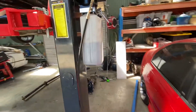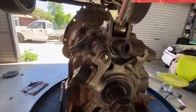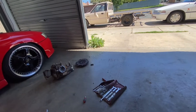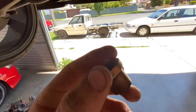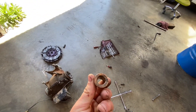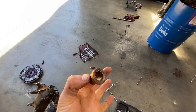Also, the VY was having trouble getting in and out of gear, and I found out why — the selector shaft is actually bent. Not sure how that happened. I've got another gearbox here and I was putting it in, but it wouldn't go in any further. I pulled it back out and had another look — the spigot bush was very loose in there and has been turning for quite some time. I tried giving it a tap to put some burrs in it so it would fit more snug, but I actually cracked it. It needs a new one anyway. I just gotta hope it was this worn and not the crankshaft.